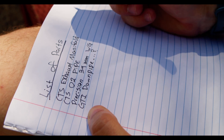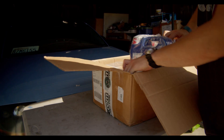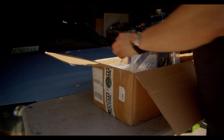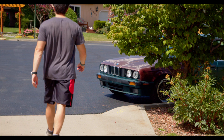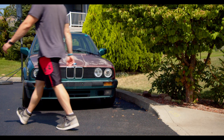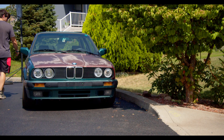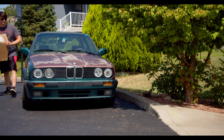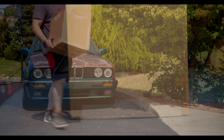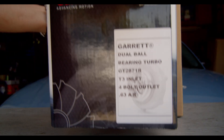We still definitely have to figure out the intake side, but that's going to be a lot easier once we have the turbo bolted to the car and we know the fitment of everything. Since the intake is very dependent on where the turbo is, we're going to worry about that later. We also have all the replacement fluids we'll need — just oil and coolant. You're probably wondering about the one piece that's missing — we'll get to the turbo. But first, a quick note on the engine itself: I do have plans to throw forged internals in there someday, but it's all about time right now. The active problem is the turbo. So rather than pulling the engine and building the kit at the same time, my plan is to get the kit working, tested, and proven with a mild tune first. Then when we want to turn it up later and have the time, we'll build the engine. But that does not at all mean we can't have fun on the stock block, and this turbo was picked for that.